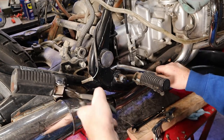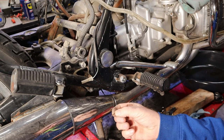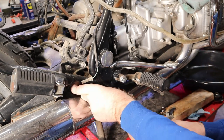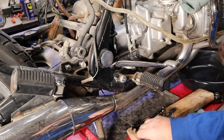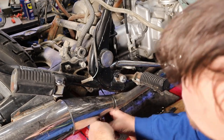If I push the pedal down just a touch, there it is. That's what we have for a cotter pin — a piece of wire, a rad nail, I don't know. I do know it's not the right thing. There's a washer on there, and then we'll slide our pin on out that attaches the brake pedal to the master cylinder.